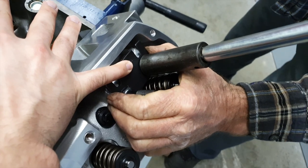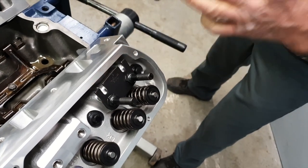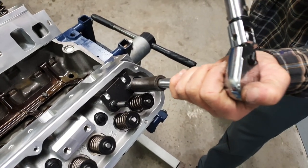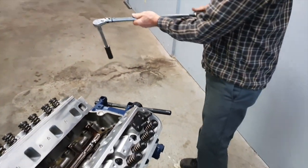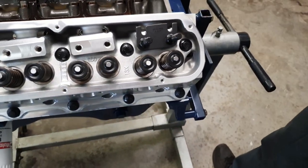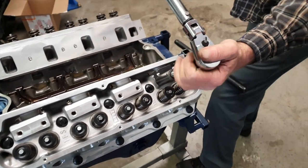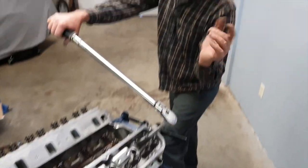Typically I hold it while you tighten it. Just tighten it a little bit — when you tighten this one it tries to flare up on the other, so just barely snug it, then tighten this one first. These are supposed to be torqued to 55 foot-pounds. So you're torquing it fully down. Yeah, 55 foot-pounds — and that's with 30-weight motor oil or you can use moly lube on it. There is a little difference between oil and moly lube on your torques, but these they just say 55 foot-pounds.